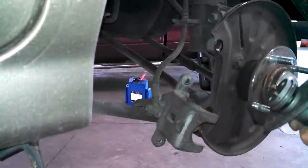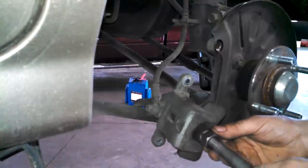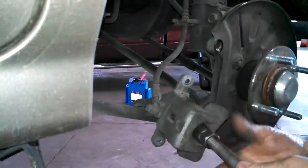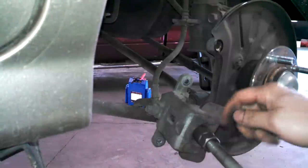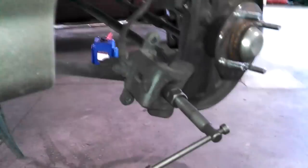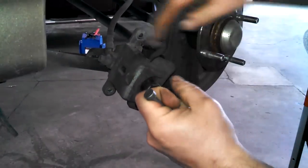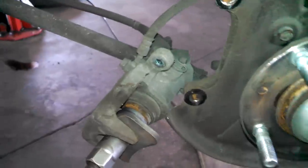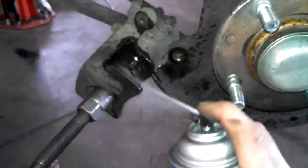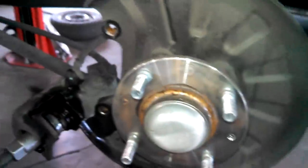Get the little fingers into the little grooves in the caliper. Turn the outer part to collapse it in, then turn the inner part to rotate the piston itself. If the boot starts twisting, free it up — you don't want it twisting and tearing. Using a little brake cleaner on there helps clean it up and may make things slide a bit easier.